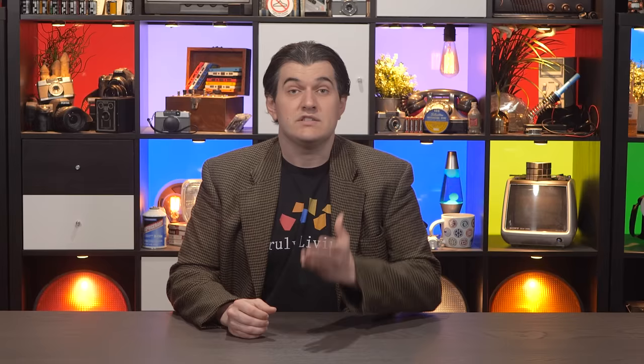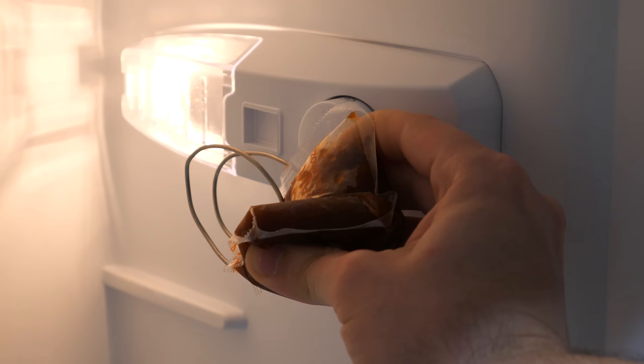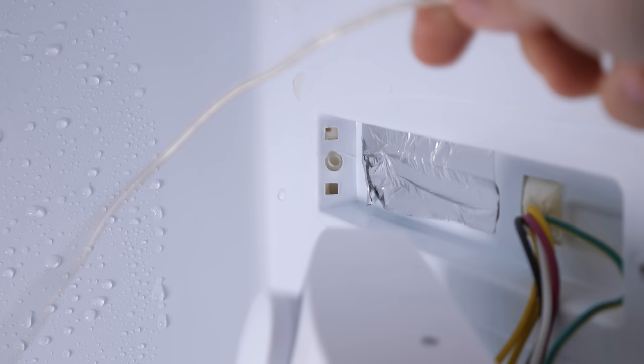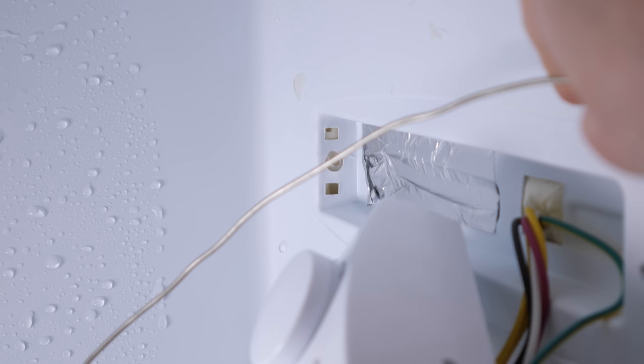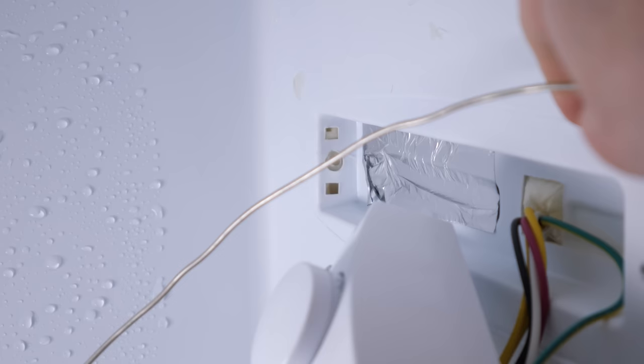To fix this utterly baffling situation, I drilled a little hole in the thermostat housing so I could poke the sensing bulb out of there and just let it hang in the air. Guess what? This also did not work and broke the fridge in a new and unexpected way. Now the fridge just wouldn't shut off, ever, not even set to the least cold setting, and not even once the measured air temperature inside was below freezing. I even tried wrapping the sensing bulb in a frozen teriyaki sauce packet, but the fridge just kept on running. Why would that be? Well, I noticed when I pulled out the sensing bulb that the capillary tube connecting it to the thermostat felt extremely cold — it was actually frosting up a bit. That suggested to me that where it lives actually gets colder than the interior of the fridge, likely due to its close proximity to the embedded evaporator lines.